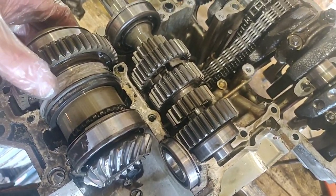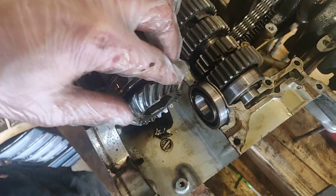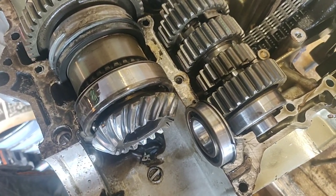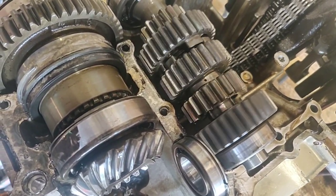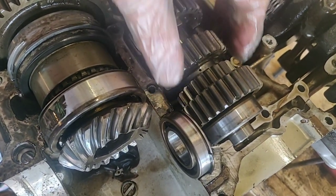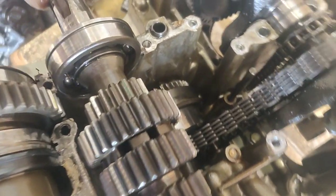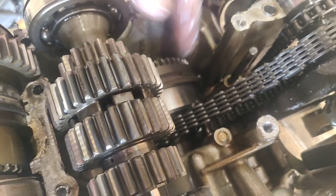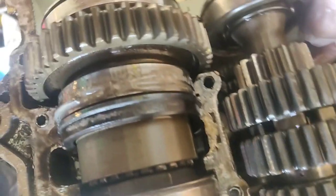Yeah, and I can actually start taking shit out, which I'm not going to yet, because I've got to work out what I'm doing, because I don't know. But most importantly, oh, gears. Yeah, most importantly, I've got it apart, and now I need to work out what I need to do. Now, I need to dig to the starter clutch, which I'm pretty convinced is that, because it turns onto the little cog you can see by the fresh air.